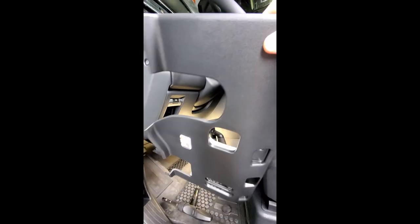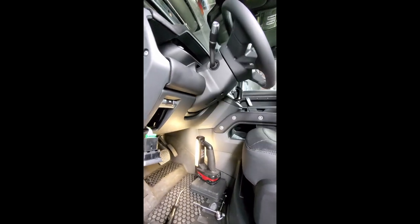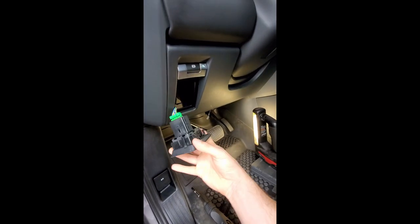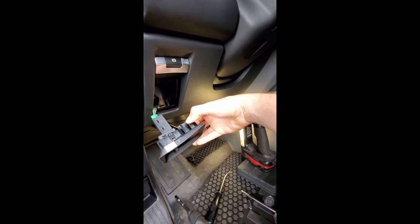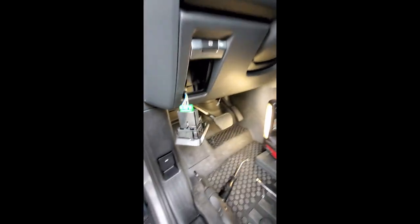Here is the panel that comes out — it just slots right in under there. You've got to take that out, and then you sort of reach behind. You are working blind, but if you look for these clips you can get at them with your hands. You're not going to be able to see them, but squeeze it and then just kind of press out at the panel at the same time, and then it pops off.